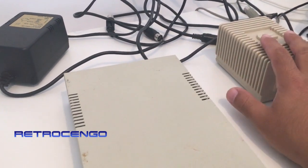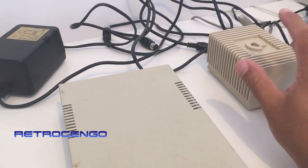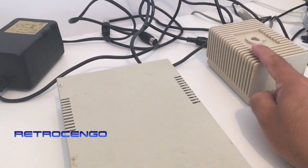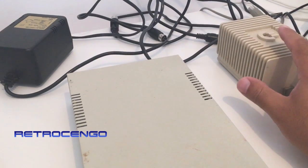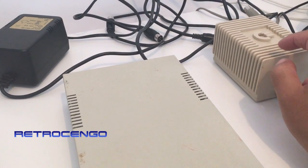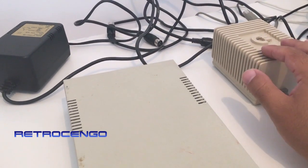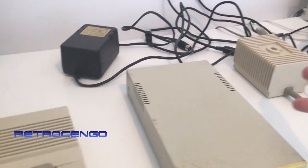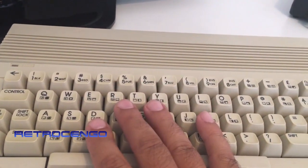This machine has not been powered on since 1991, and please do not just give them power with the old PSUs before you test the voltage. If the 5 volts is lower that's bad, but sometimes it's much higher — 6 or 7 volts — and it will destroy the chips inside the machine.